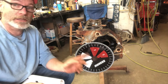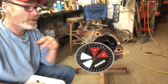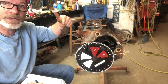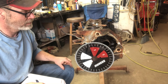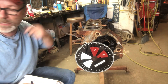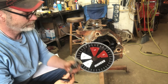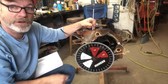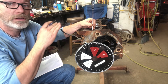Basically what I've got going on is I've got the degree wheel on here. I haven't found top dead center yet. I'm gonna use this piston stop - install the piston the normal way, run it up until it hits the stop, write down where we're at on the degree wheel, spin the engine the opposite way until it hits the stop, write down where we're at, find exactly halfway between those two, and find true top dead center. Once I do that I've got the deck marked with a sharpie and we're gonna take the measurement from the same spot every time. I'm just gonna use my calipers - I'm gonna measure down to find piston position at different degrees of rotation, going every 10 degrees like I talked about in the other video.